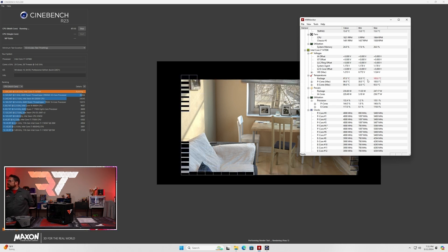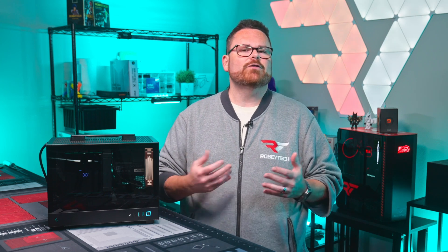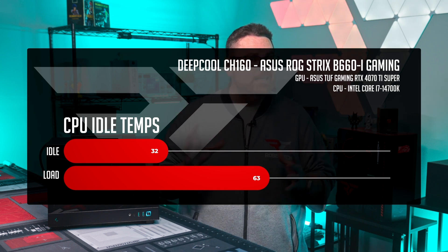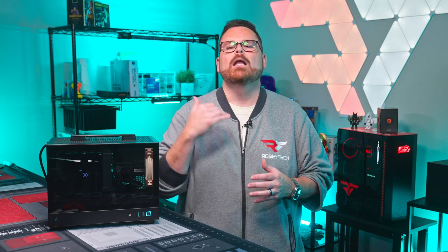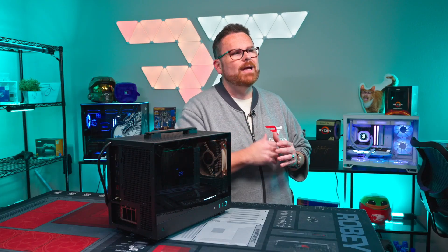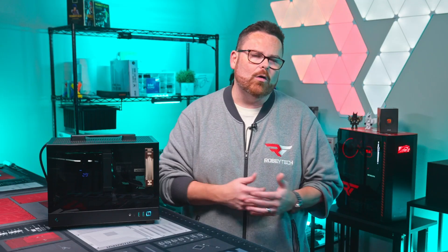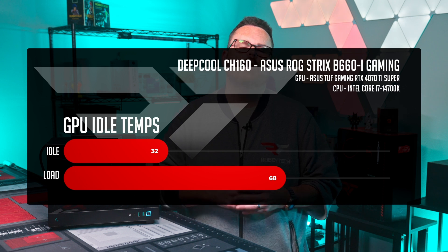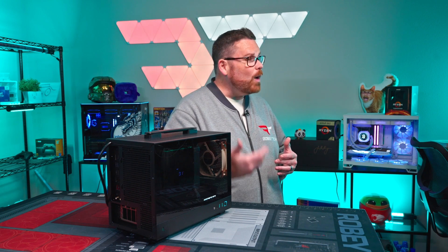Post-stream, before filming this video, we added a contact frame to see if it improved cooling. With the contact frame, at idle we saw an average of 32°C. When we cranked it all the way up and ran Cinebench, we saw our average pop up to around 95°C. For gaming, we saw a nice and cool 63°C average across all the titles we tested. So we're looking at the max this air cooler can handle for long-term CPU-heavy tasks like rendering or compiling without major throttling. Remember, it's important to enable all the Intel power limits in the BIOS to see similar temperatures. For the GPU, we had no issues with the 4070 Ti Super — idle was 32°C and under gaming load averaged around 68°C. If you want even better results, swap the front fan for a 2000 RPM NF-A12.